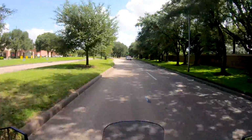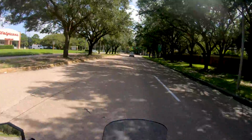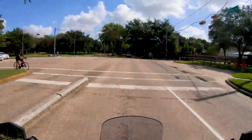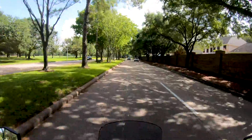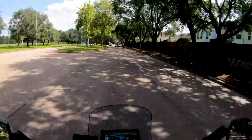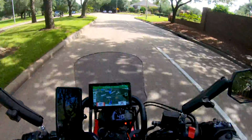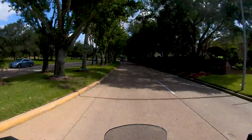There's not as much resistance, and the gearing is different, and the engine on this is tuned for a little bit more mid-range, a little less top end. So those are all three things that don't do well for long, high-speed running, and the Cub does that just a little bit better. So yeah, there's my red temperature warning light, 83 Celsius, and it's going nuts.